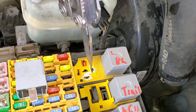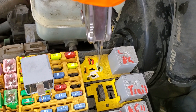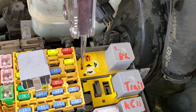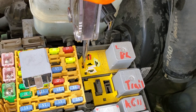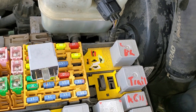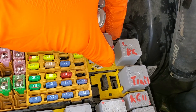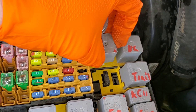These other two pins are involved in actually triggering the relay and getting it to engage. This pin is a ground signal coming from the powertrain control module — you should see a ground here. This other pin carries the power from the ignition switch, so when you actually turn the key to the start position, you should see power here, assuming that your neutral safety switch is working. That's a safety device that prevents you from starting the car when you're not in park or neutral. I'll show you where that power comes from — that's where our second fuse comes into play.